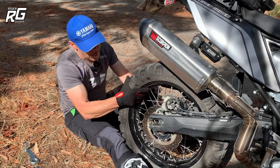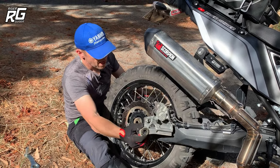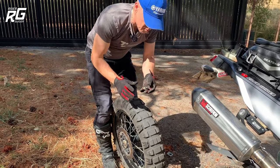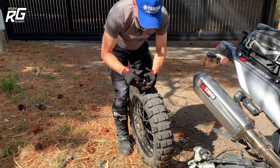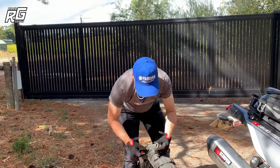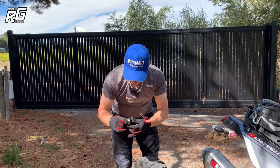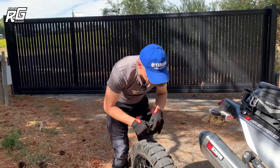I'll just drop the wheel out — job done. And that's the issue with the caliper — there we go. Back wheel's out. You'll notice the spacers there — it's worth having a cloth or rag to clean these back up. I've got a wheel spacer this side and one for the other side. These aren't Yamaha ones — I've got these from Rally Raid. They've got a slight beveled edge, better seal, higher quality than what Yamaha put in, and they last longer and don't tarnish.